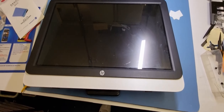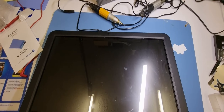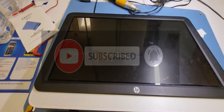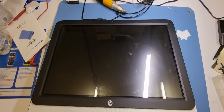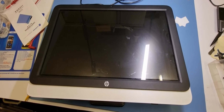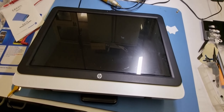Welcome to another video. This HP all-in-one desktop computer came in a couple of days ago. It's not the touchscreen model, a little bit older, but a good working machine. It's been to another shop and they couldn't diagnose the fault — they said it's got blue screens. The hard drive tests pass, but when you move the mouse around the screen it kind of freezes for a second. Memory is fine, so I suspect it's the hard drive. We're going to pull the back off and replace it with an SSD, which will make it run about five times faster.